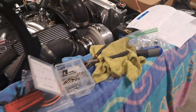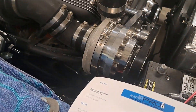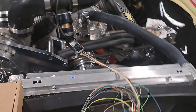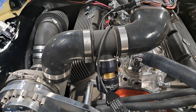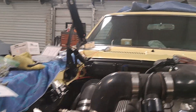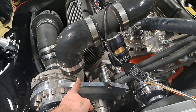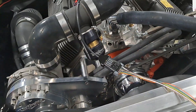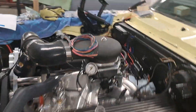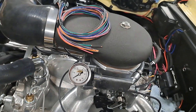My goal is in the next two to three weeks to actually be able to start it. I also kind of want to take the torque storm off and send it to them to have it checked — I just don't want to do it twice. The other thing I'm worried about is that 90-degree bend — I don't think that's going to fit underneath the hood. The other option they have has a straight-clocked compressor housing, which looks like it'll help. There's also a slight chance to fit it under the cowl — I've seen a few where they modify it, but it's got to fit closer and tighter.